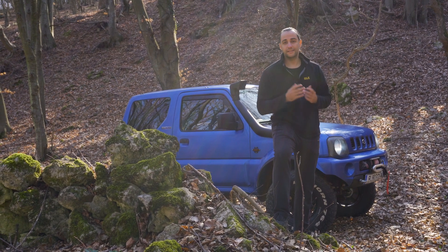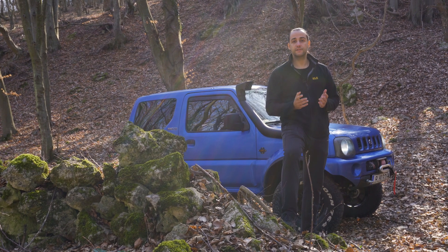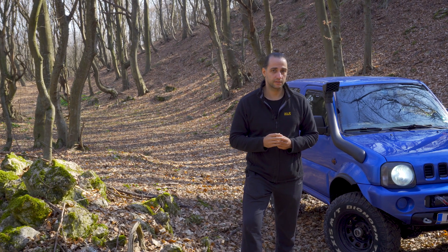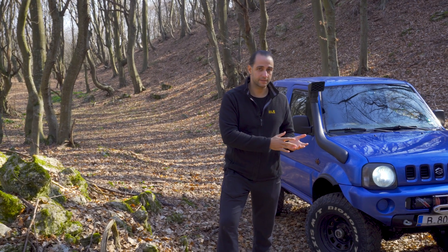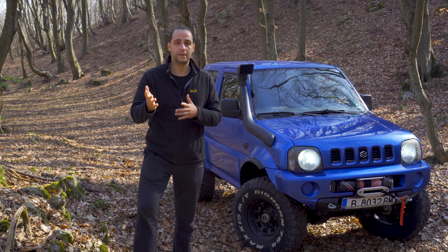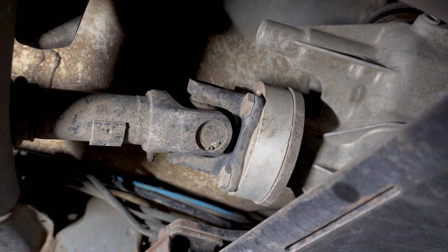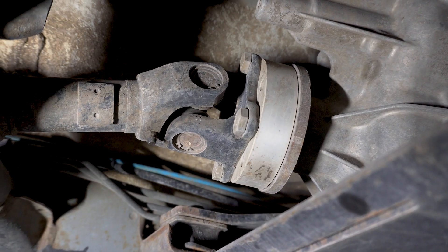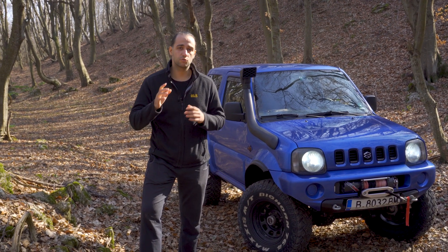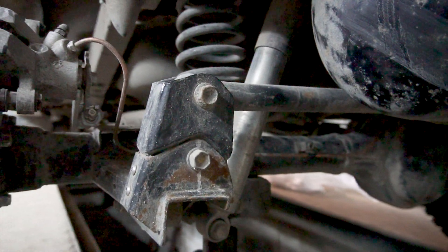And finally, the four-inch lift. Unless you have a big pickup truck, this is pretty much your limit and as high as you can get. If that's your choice, congratulations — you're making the first step into having a true off-road vehicle. What do you need? First, even longer brake hoses. Then, even better caster-corrected radius arms. And then, an even larger prop shaft spacer. Some vehicles might not have a prop shaft that can work at these extreme angles, so you'll need a brand new prop shaft with high-angle capabilities — note that for some 4x4s a high-angle prop shaft will be needed even at 3 inches. And finally, the panhard bars: they not only need to be adjustable, but it's a good idea to drop them lower. Restoring a closer-to-stock position of the panhard mounting point helps reduce parts fatigue that builds up when turning the wheel.